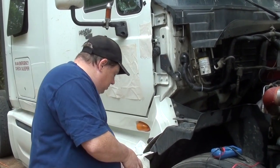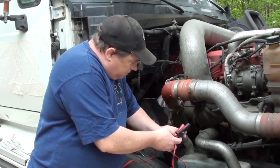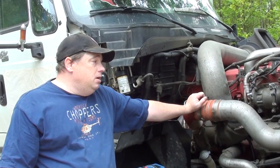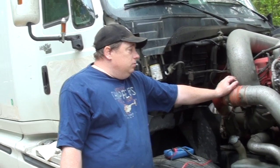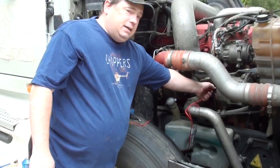Now, the reason why I was talking about the engine fan, when you're using this, this is very important. When you reach over here and you click that thing on and that clutch compressor kicks in, if you're charging this thing up, shaking your little can, and that engine fan comes on, you know the system is getting enough pressure that it deems it needs to reduce the pressure. If that engine fan suddenly kicks on, and it's not because your motor's getting hot, it's because the AC kicked it on, then I don't recommend leaving this plug and that clutch turning for more than about 30 seconds after that.